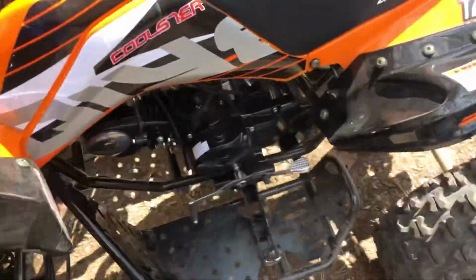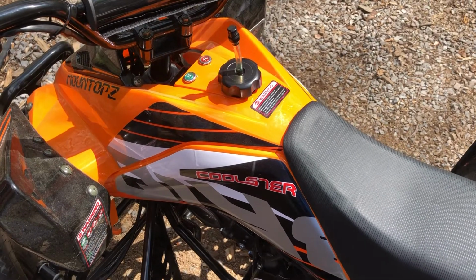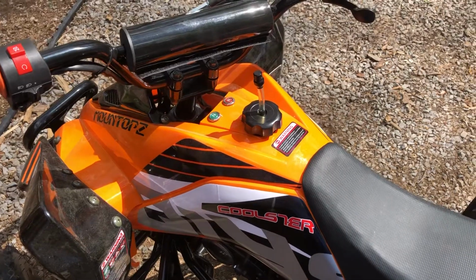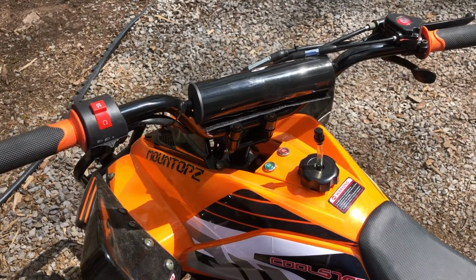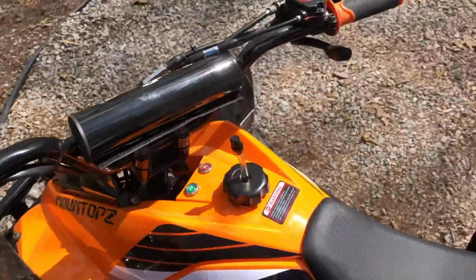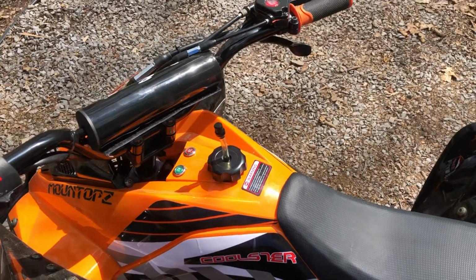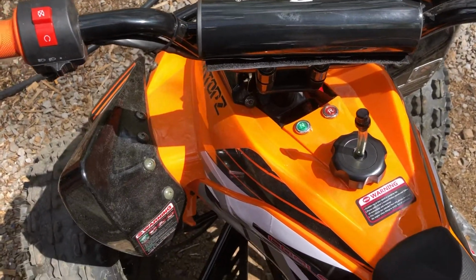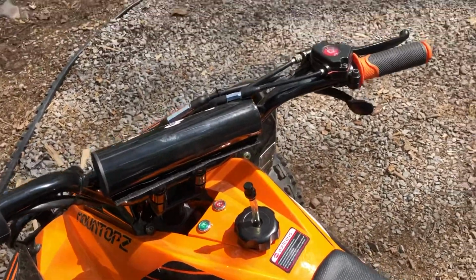And I'm really glad I did this, because the air-fuel ratio screw was turned all the way in and then had the cap put over top of it, which is pretty useless, and it gave it a massive dead spot all the way through the mid-range. It ain't warmed up. There's no choke. Got a much snappier throttle now.